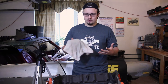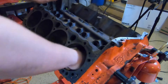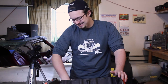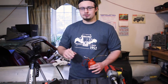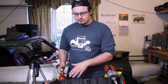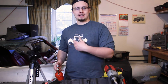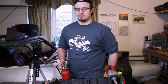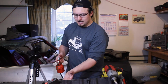The first step in this process is to take a rag and go in there and clean out any loose dirt or cobwebs if your engine has been sitting out for a while like mine. Just get all the loose stuff out before you go, because there's no reason to leave it in there. Now once you're done wiping the loose dirt out with the rag, you're going to want to take your oil — whatever form it's in — and spread it around the cylinder. You don't want to put too much so that it's flowing out the bottom, but you want a nice layer around the entire cylinder. Make sure you also get some oil up around the top of the cylinder.